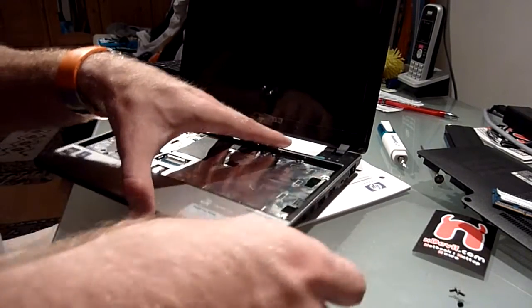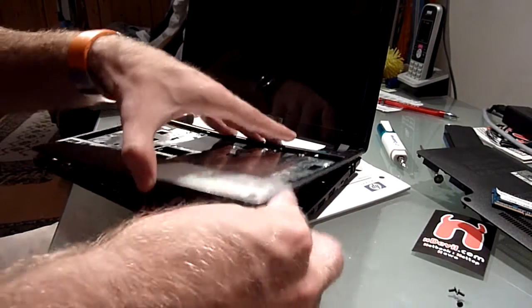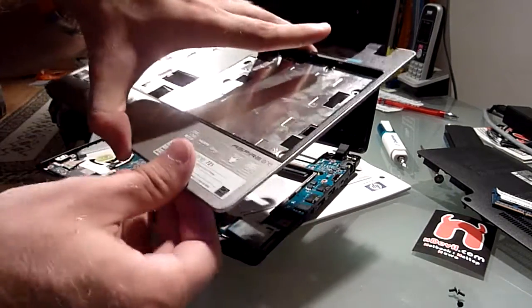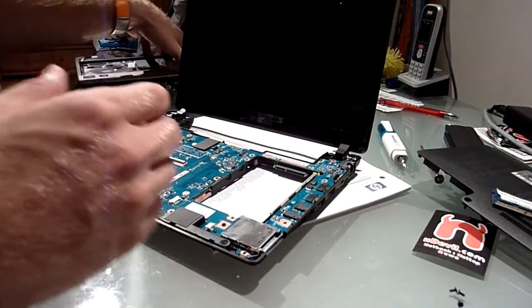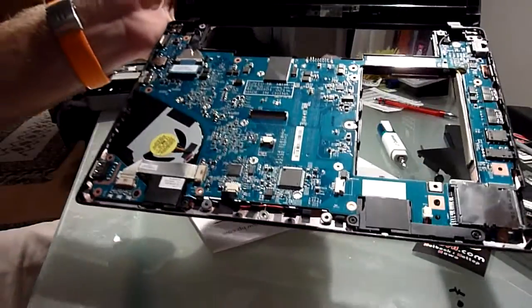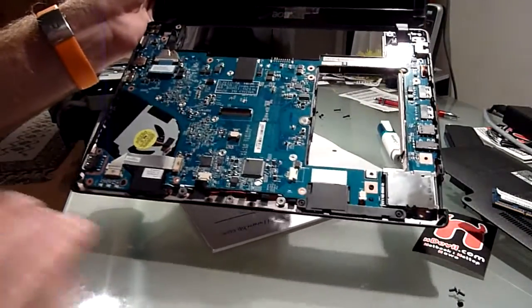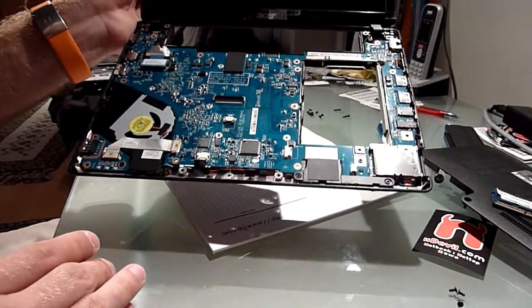Then you need to take the card again, go around the edges, and then you can just lift off the whole top like that, and get a nice view inside your netbook. For all this, please remove your battery. Even if you upgrade the RAM, always take out the battery so there won't be any power surge.